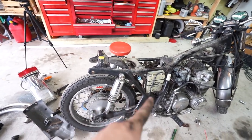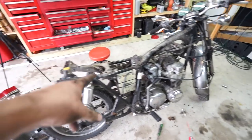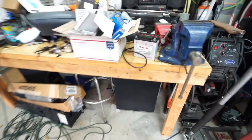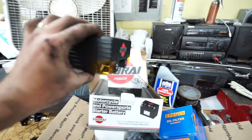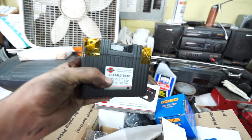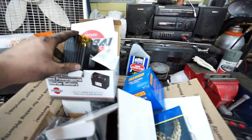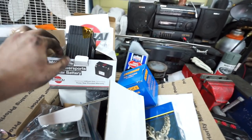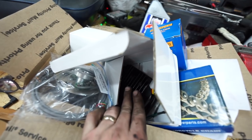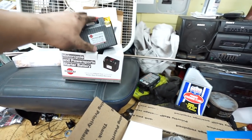I'm probably going to pull the battery out since we won't be starting it anymore until it's back assembled. My frame hoop is on the way, so is my seat — a bunch of parts already came in: electronic ignition, modern regulator rectifier, and a new lithium ion battery, which is pretty awesome — super small but it has the same cold cranking amps as the stock battery so we can keep our electric start. These batteries are internally voltage regulated, meaning they're not as sensitive to old charging systems, so even with a modern regulator rectifier it's an extra level of security, and you can't overcharge them.